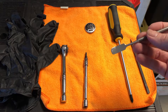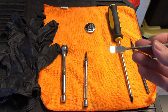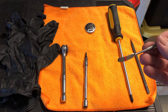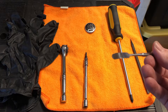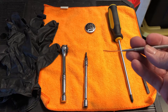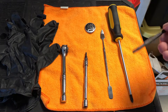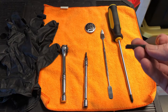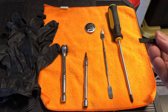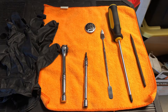This tool here is what I used to actually disengage the boot bracket in the car — I'll show you the exact points to do that. When I was watching other videos, some guys were struggling using different pry tools and it made me wince because it could damage the silver and plastic parts. This is a pry tool actually used for computer repairs. Just make sure whatever you use is thin and durable, because I also used a black spudger — also used in computer repair — and it actually broke, so be careful.